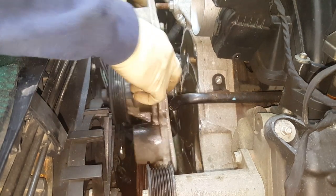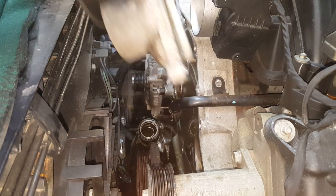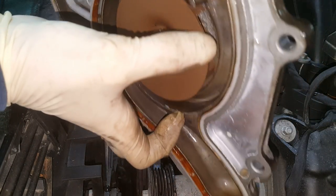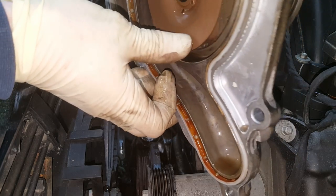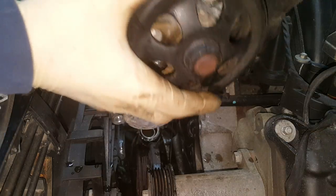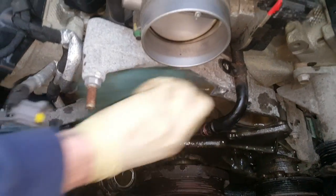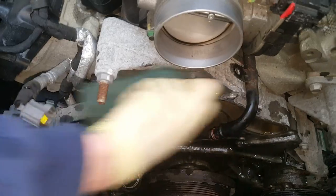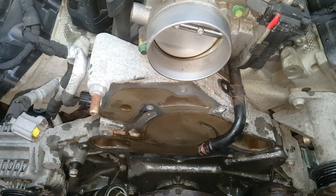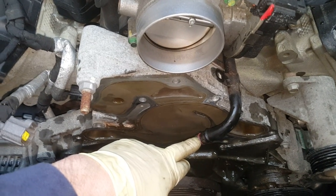This water pump is ready to pull off — we're just going to pull it out of there. You can see the impeller on that one; it looks pretty good. This one was actually leaking from the weep hole, indicating that the water pump ball bearings were starting to fail — that's why we're replacing it. In most cases, that's where they usually leak. Next, you just want to take some emery cloth to the surface of the gasket area to make sure it's nice and clean. This one had a rubber gasket so it's relatively easy to get the surface clean. Also, we're going to be replacing the o-ring where the coolant tube goes into the water pump.